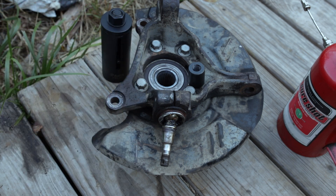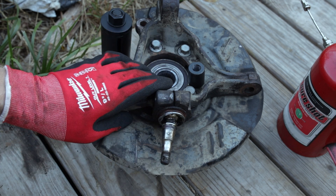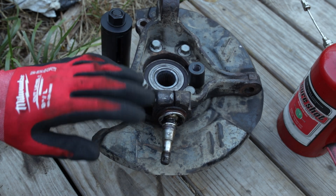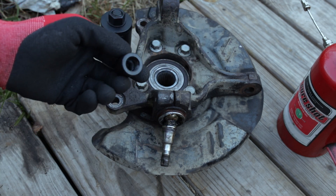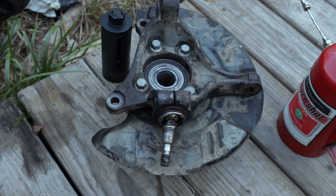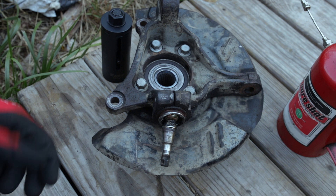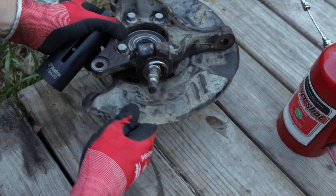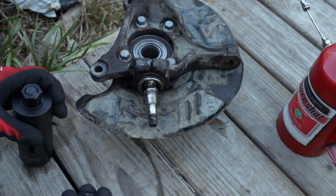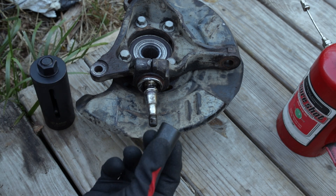But that's not what we're here to talk about today. We're talking about this Astro Pneumatic tool for actually getting the ball joint out once you've gotten here. This car was quite rusted — I've seen way worse than this, so honestly I probably could have got it out without this tool. But for the price — I think it was about $24 or $25 on Amazon, I'll link it in the description — I also have it in my Amazon storefront. We're going to go ahead and use it right now to extract this ball joint from the steering knuckle on the 2007 Outback.